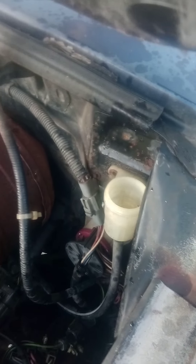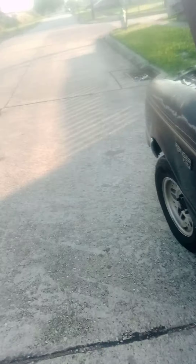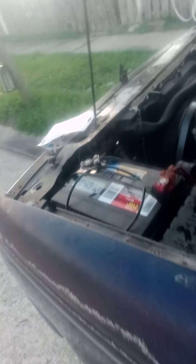But I literally sucked it out and I emptied it back in. After it comes up three-quarters of the way I emptied it back in, I sucked it out again, I emptied it back in, and then my clutch was starting to feel hard — it wasn't spongy anymore. I just took it for a test drive, man — I just fixed the clutch problem. It needed to be bled; it had air in the lines.